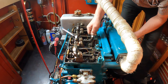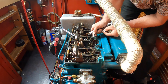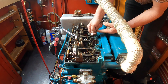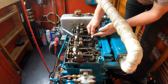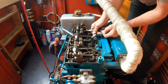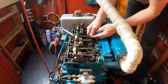That's a nice little bit of drag. Although you can see it's going in there, you can see I'm not forcing it. If I was to get a bigger feeler gauge — 0.19 — massive — see, that won't go in. But I could force it in — and you can tell it pushed the valve down, because you can hear the valve spring back up. Get this one in — absolutely perfect, just a last bit of drag. It says 0.05 to 0.10. So if I put the 0.05 in, that's loose. And then if I put the 0.10 in, you can see that's tight. But it doesn't actually spring the valve up, so it's not too far away. So the middle road — 0.07 — perfect. Right, that's that one.